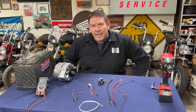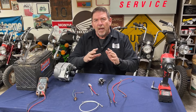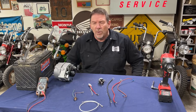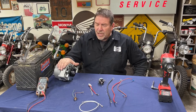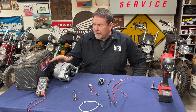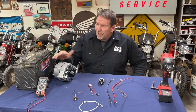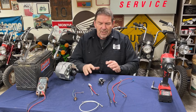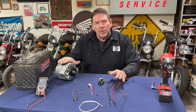The old van has got an issue with the wiring — it's just a mess. I've actually purchased a new fuse block and all new wiring harness, and that will eventually get installed in the van and we'll do a video on it. When that all happens, one of the things I want to do is change out the alternator. It currently has an alternator with an external voltage regulator, and I want to go to something more modern with an internal voltage regulator — a GM style 10SI alternator. I think it has a little simpler wiring, so that's what I'm going to do.